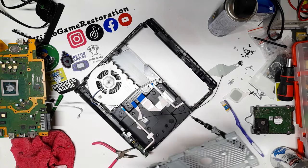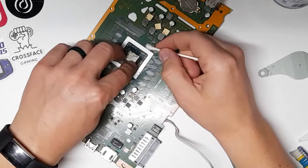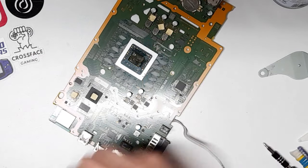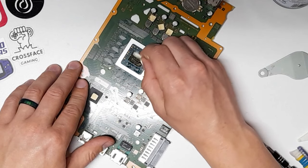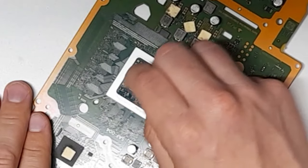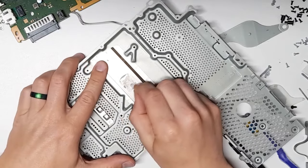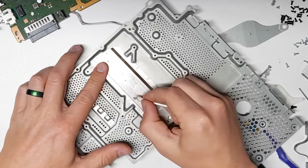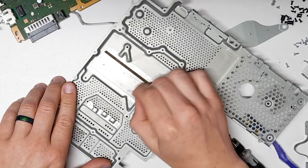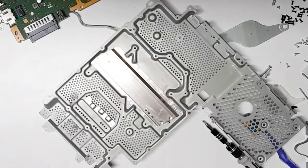Same idea — I'm going to use compressed air. Now the air gets sucked in this way, so I'm going to blow it out this way. All blown out. I'm just going to get a toothbrush and get some of the dust out of the fins. And then I'm going to blow away all the dirt I just blew onto my table and my now-clean PS4. Now I have my board — I'm just going to take off the old thermal paste. These edges usually come off in big chunks. If you ever have trouble cleaning off thermal paste with isopropyl alcohol, try moving to a contact cleaner — I found that it works extremely well and really breaks it up. I've only had to do that a couple of times, mostly on 360s. Then I'm going to do the same to the back of the heat sink — just want to make sure it's nice and clean, free of any debris or dust, and you want it to kind of shine back again.